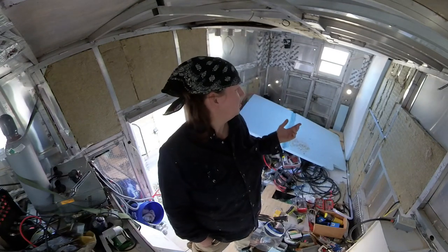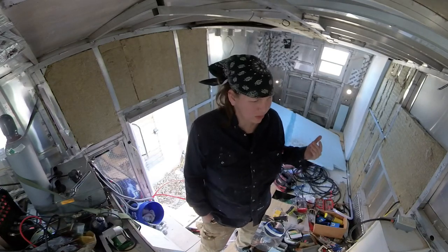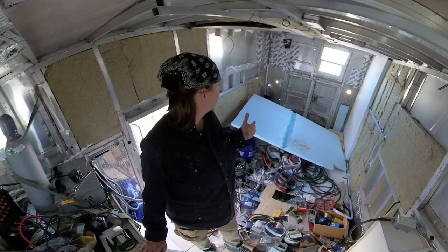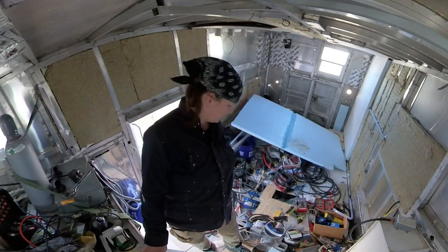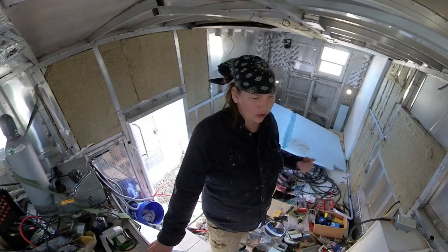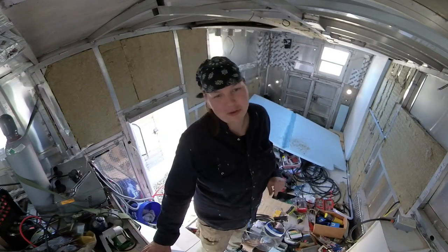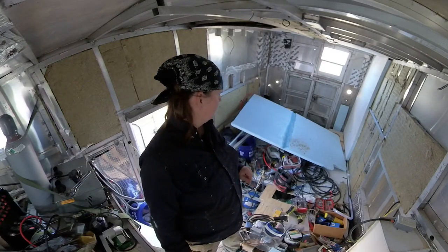The supports, the way the ambulances are designed, they're designed to do a full rollover and maintain their shape, which is great. I have modified it to a point that I actually raised the roof 27 inches. And so that's most of the living space we're living in. We have the floor raised up about 16 or 17 inches, and all my tanks are inside in the floor with radiant heat underneath it to keep it from freezing. That is another story for another time. We'll go through a tour, and I'll tell you about everything when it's all working perfectly. It's not working perfectly right now, but it does put heat in here whenever I need heat.